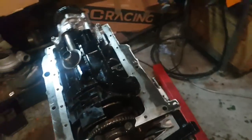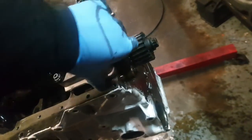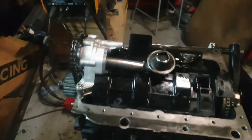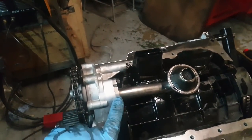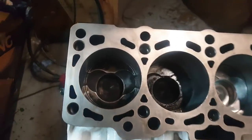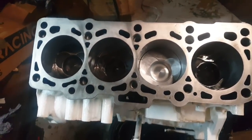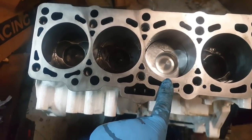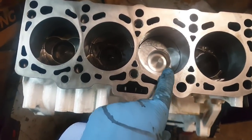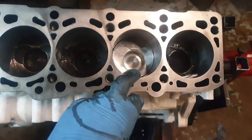The oil pump is fitted. The piston is already in. The chain and the tensioner — everything is in. As you're building the oil pump, don't forget it has a seal here. If you miss this seal, the oil pump won't work. The piston is already in. You're probably going to ask why this piston is a different color — this piston was used and the crank went and damaged it, so I bought a new one. That's why one piston is old and this one is new.